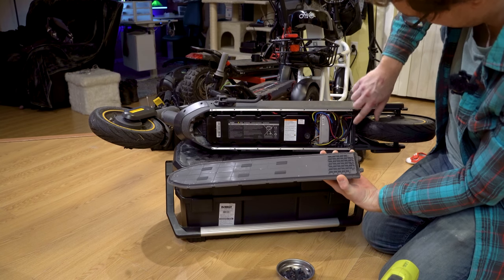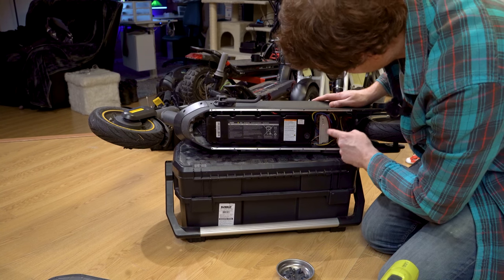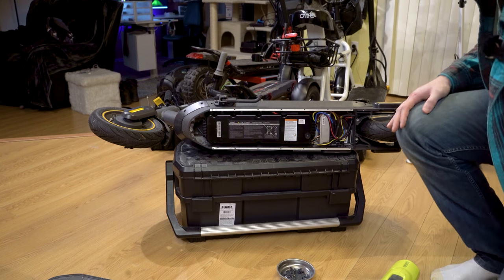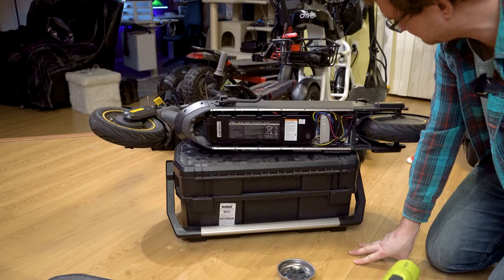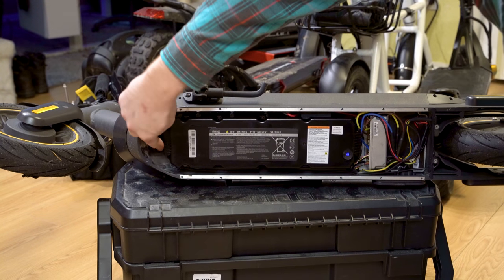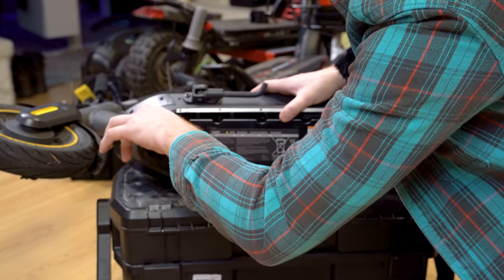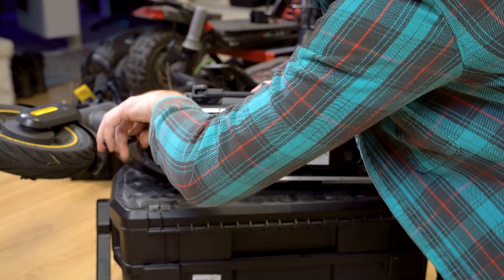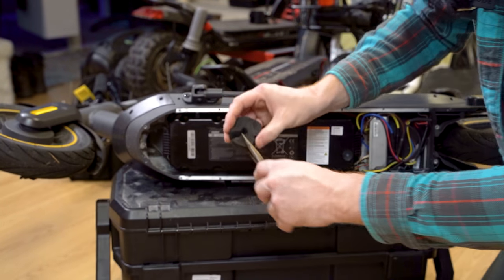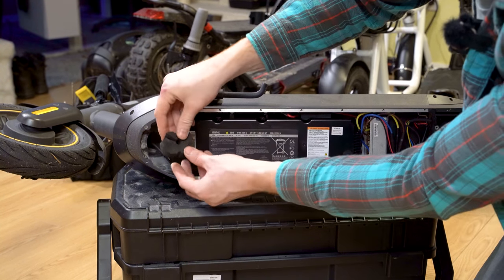The plate did have a little waterproof tape sealant on the back, so it sticks a bit, but came off relatively easily. Here are your motor wires, controller, and your battery — mine is blinking blue, but the scooter is off, so that just blinks all the time. The reason we're taking the bottom off is to thread a cable through where the rubber gasket and brake line go into the scooter down into the battery compartment. I've got a little set of needle nose pliers to grab and pull the foam out of that hole in front of the battery pack. Got it — there's a slit in it so you rotate it and slide the cable out through here.